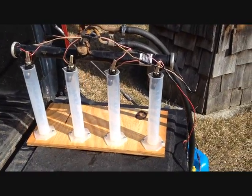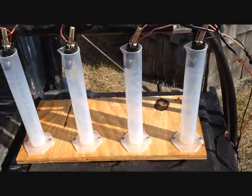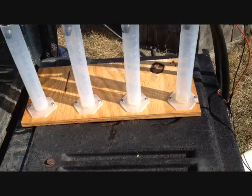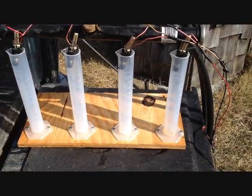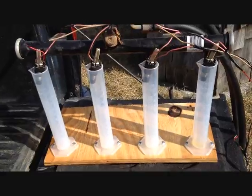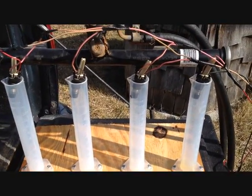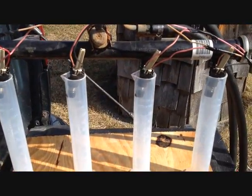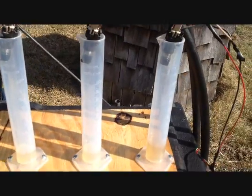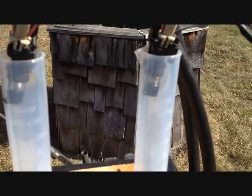I'm going to turn the fuel pump back on and do the dynamic now. Fuel pump is on, and that guy's already starting to spray — so it's stuck open. I'm probably going to do the dynamic twice because it sprays so little; I need to adjust the settings in the Arduino. Dynamic testing — that one's leaking so that one's going to be off. The dynamic testing kind of sealed that one back up, so maybe it just had some dirt on it because it's not spilling out anymore.